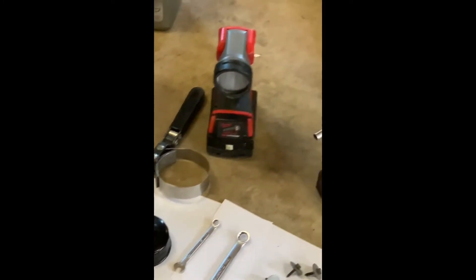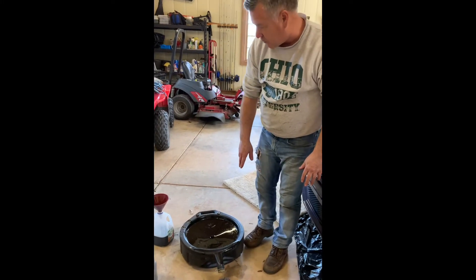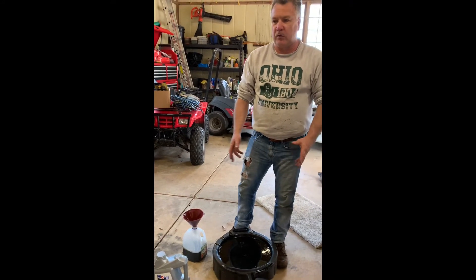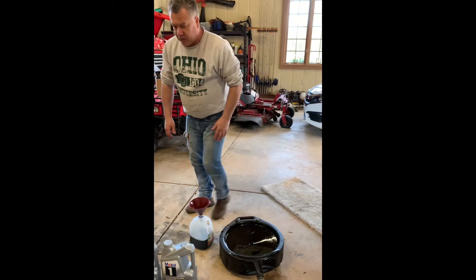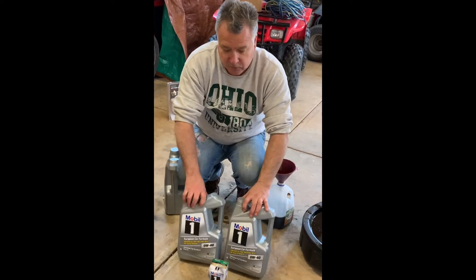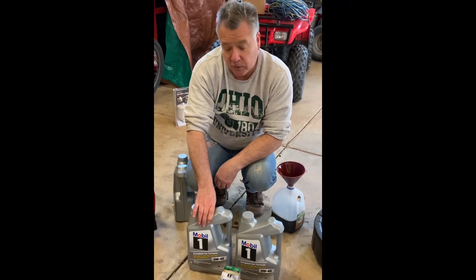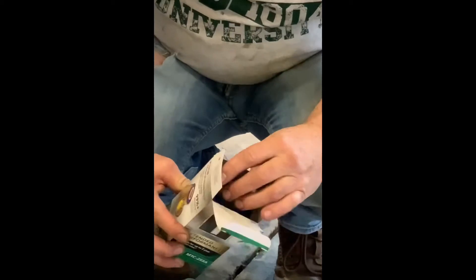Have a plastic bag handy so when you take the oil filter off you can put it straight in — it's a little messy. You'll also want your drain pan. When we're done we'll pour the old oil back into containers and take it to an auto parts store like AutoZone to get it recycled. Have a funnel available for refilling. The oil I like to use in this car is a European car formula, Zero W40 — it performs very well in European cars. You need nine quarts; these five-quart bottles run about $24 at Walmart. For the filter, I like more premium brands — Mobil 1 or Wix are good. These are cartridge type filters and they come with the gaskets to replace if you'd like.